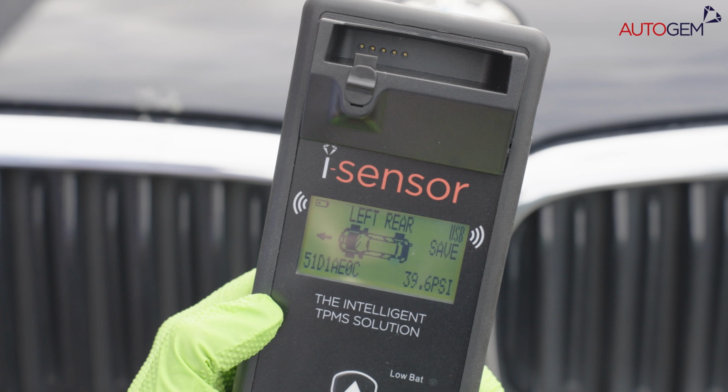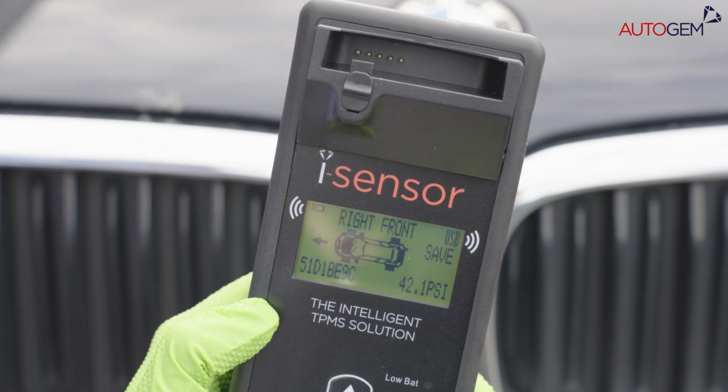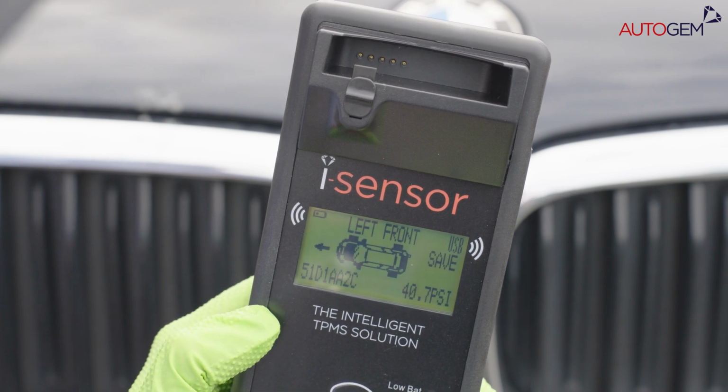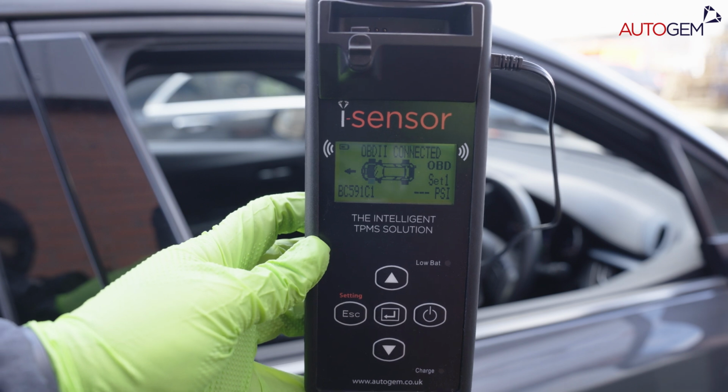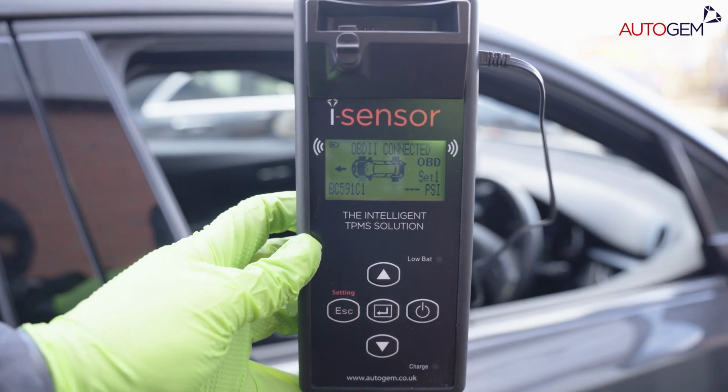This can be useful if you need to compare the sensor ID codes to those stored in the ECU in order to diagnose pressure monitoring system malfunctions. We talk about sensor ID matching with iSensor Original in more detail in its own training video.